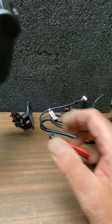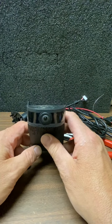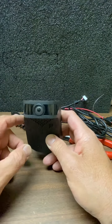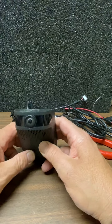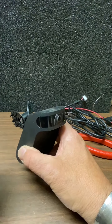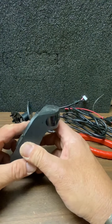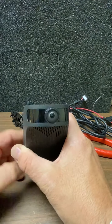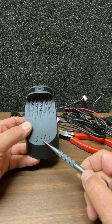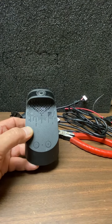On these N3 cameras, if you install one and see red lights in the front, red lights typically means the camera is bad — but do not go any further with the install yet. What Nauto has found is that if you're swapping a device out and the red lights come on, call Nauto tech support and let them physically swap or RMA the device in their system. They'll reprovision the device over the air, the red lights will go away, and it'll operate normally. Old rule: red lights, get rid of the camera. New rule: red lights, call Nauto tech support. Also, the reset button is still between the volume down and volume up buttons — use a paper clip to do a hard reset if needed.